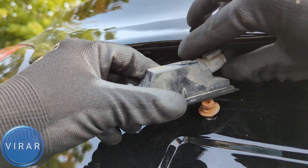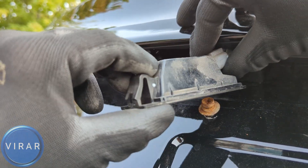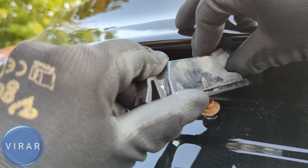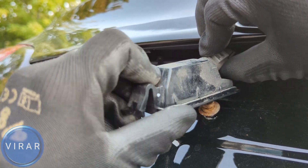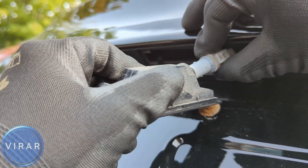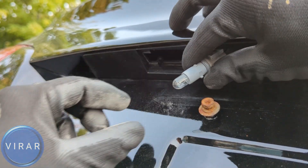It's out. Now what you can do is hold the black light and twist the gray bulb holder left. Or alternatively, you can hold the gray bulb holder steady and twist the black light left. It's loose. Get the light out and there's the bulb right over there. To get the bulb out, just grab the bulb and pull it out straight.